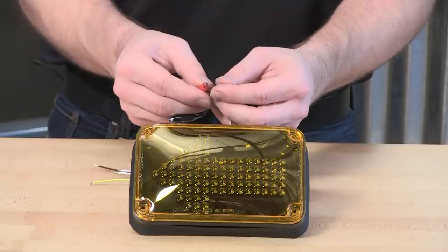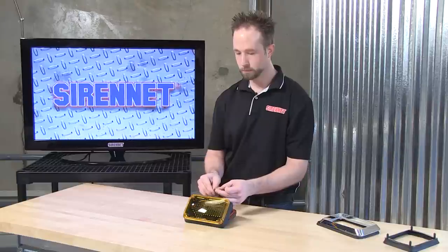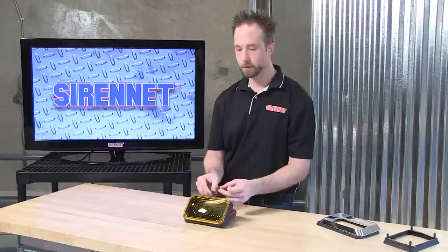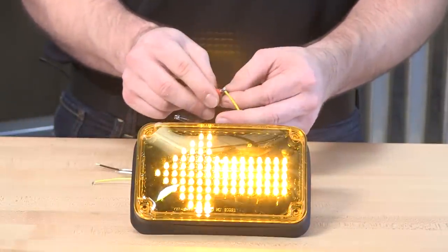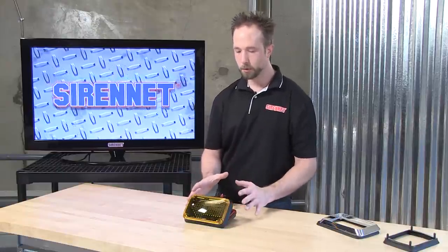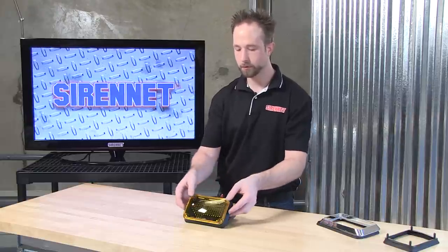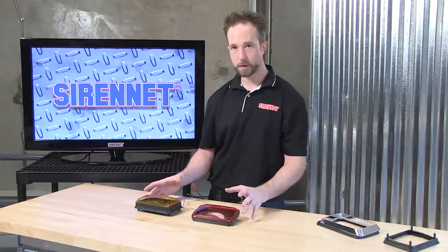As you can see with demonstrating the ScanLock and power back and forth to the trigger wire, there are several different modes that the arrow can be configured to display in. In this case, you can see that it's actually mimicking what the brake tail turn does when it does its 4-flash quick flicker. Quite easy to program and set up to your wanted specification for the arrow — you can do adjustments to the 600 series brake tail turn itself as well. I'm Chris, thanks for joining me on Sirenet Television taking a quick look at Whelen Engineering's 600 series brake tail turn light head, as well as its partner, the arrow fixture. Back to you, Stuart. Well, there you have it — a brake arrow overview of a 600 series LED from Chris. Thanks Chris. And you've been watching Sirenet Television, I'm Stuart.